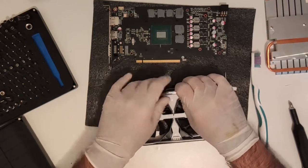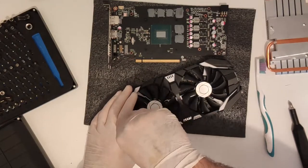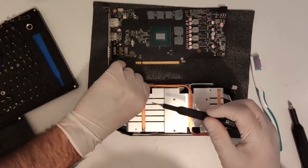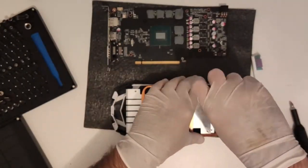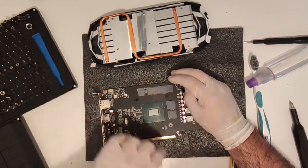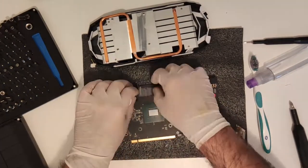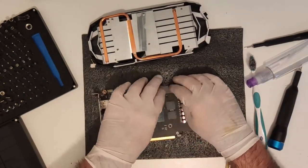This signaled that incredibly the GPU die is making better contact with the cooler than before, although a lot of that difference can be put down to the fact that the MX5 thermal paste I used is much better than whatever came from the factory. In terms of absolute temperatures, the core went down from 78 to 70°C and the hotspot is now hovering between 76 and 78°C — way below the 82 to 84°C previously experienced. I stress tested it for a couple of hours and in Heaven the memory temperatures at the approximate spot I measured before went from 84°C down to a much nicer 72°C.